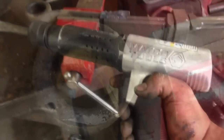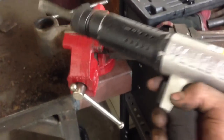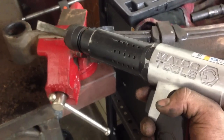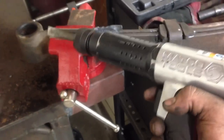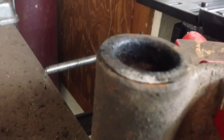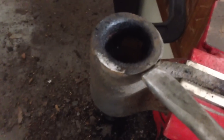Another handy tool to have is a long barrel air hammer — a hell of a lot better than those little tiny pieces you get from a general auto parts store. This thing will knock some rivets out, real handy. What I'm going to do: I have the bushing with the metal sleeve side up. Over the other side there's nothing there, so I'm going to roll this edge inward and then hammer the whole thing out. Let me get this started and I'll show you what I'm going to do.